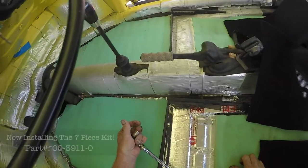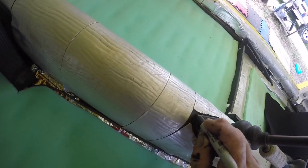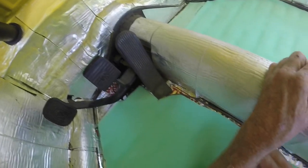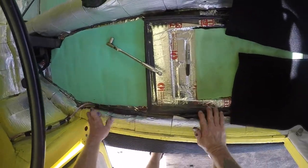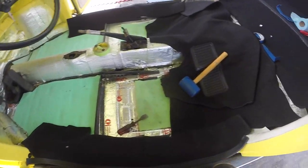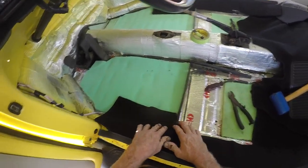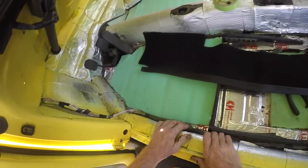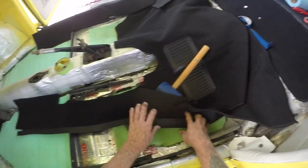For a good point of reference, mark about where your shifter was because we're gonna remove it — not that hard to adjust them, just kind of get an idea of where it was. We're going to get this removed, then get to putting the piece on the firewall, these two pieces, and then those pieces. Now another thing — get in here and run your speaker wires, put speakers in the back. Now is the time to do it. I go up through there and the carpet should hide all that.